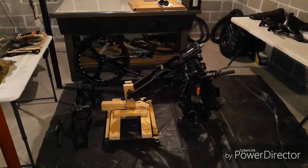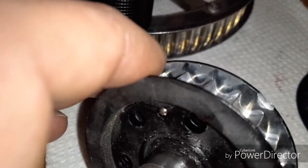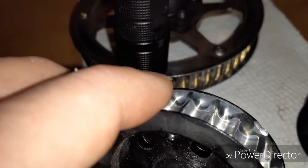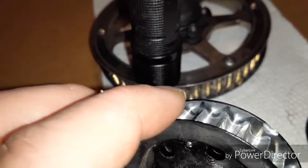Notice the secondary front pulley. It's aluminum, and that's what caused the belt to fail. I'm going to show a picture of it here. Okay, this is the original one. You can see how this is aluminum. It's really light, and there's nothing wrong with using aluminum parts on certain applications, providing that the aluminum density is sufficient.